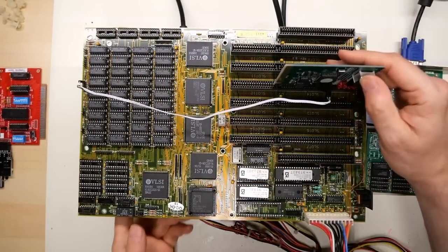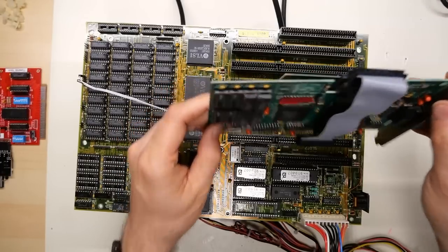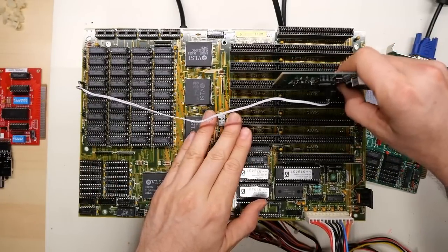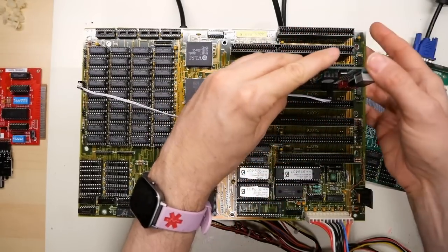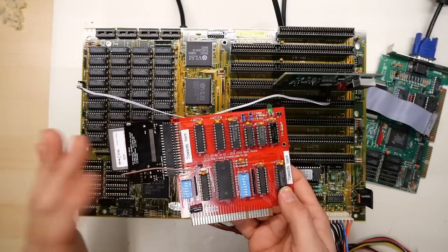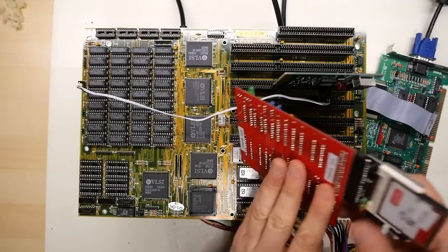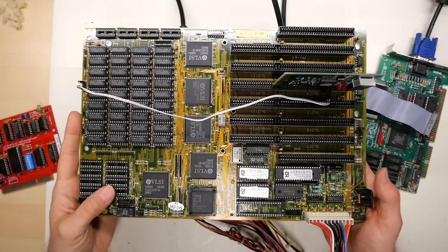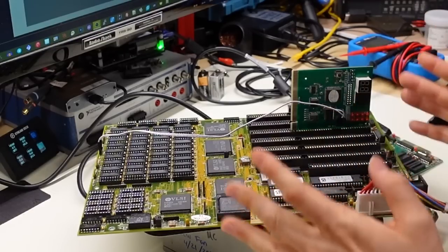We are going to plug in the postcard into the motherboard. It has a little wire for the speaker, because you can get useful beep codes from a lot of BIOSes. If the computer is executing code but say the RAM is bad and it can't initialize the video, you'll hear a beep code. Make sure if you buy one of these — and they are only a few dollars — that you don't plug it in backwards. ISA cards always go in with the circuitry facing the power connector or keyboard connector on a normal AT motherboard. I know this because I did that on my XT IDE and it caused damage.